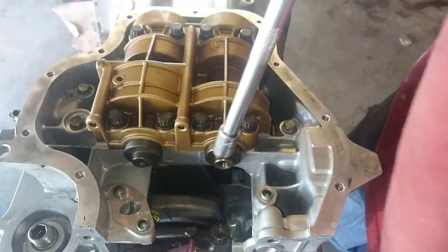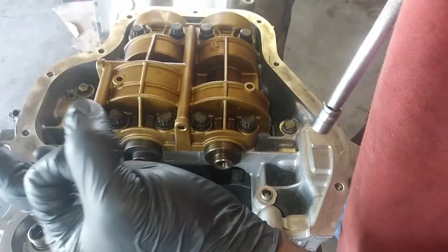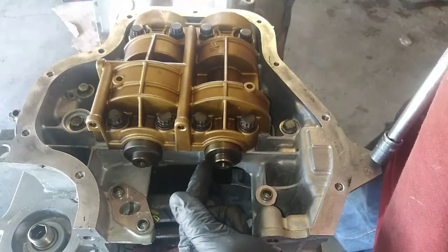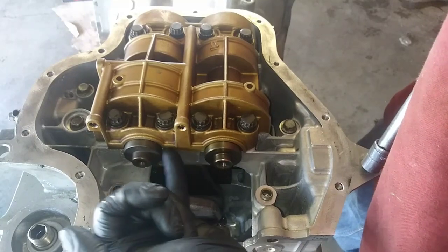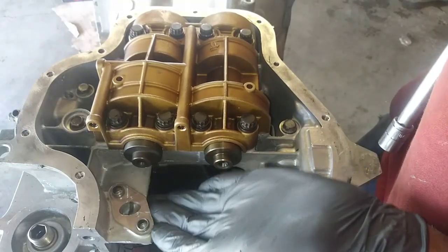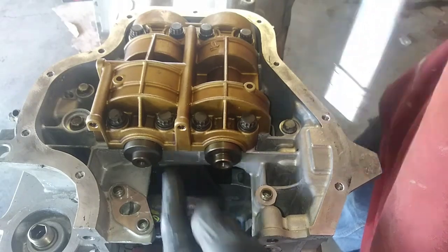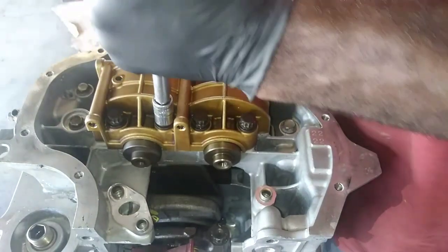You saw the painted holes at the bottom. These were actual holes. There's going to be like an imprint of a round hole, but it's not going to be an indention. There's just going to be a print there, and they're going to be facing the 90 degrees. So if they were aligned properly, like offset slightly, those two holes will be matched together. You're going to tighten these down at 16 foot-pounds and 90 degrees.